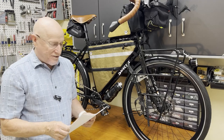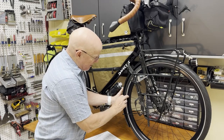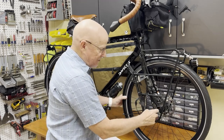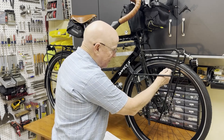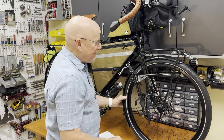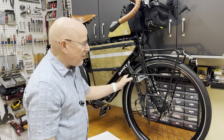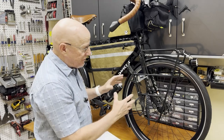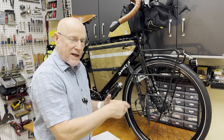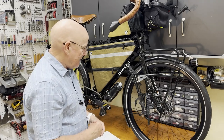Here's something that involved a lot of decisions: the wheels. There are a lot of parts to a wheel — the rim, the tire, the spokes, a through axle, a hub, nipples that connect the spokes to the rim, and tape on the inside of the rim to help hold the air in. That's one thing I did not put together myself. There's a real art to building a wheel — tuning the spokes so it's perfectly round and super strong. I had that done by somebody in downtown Nashville at Halcyon Cycles who does basically nothing but build wheels all day, and she's really, really good at it. This bike has way more spokes than my road bike because it has to be so strong.